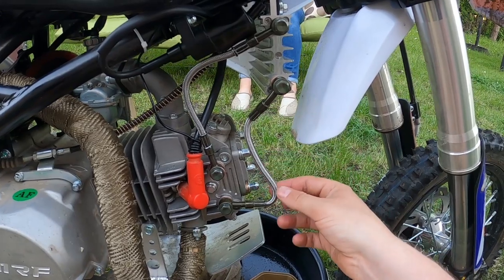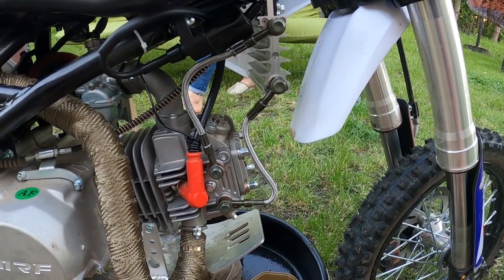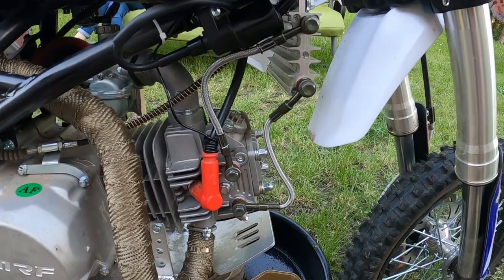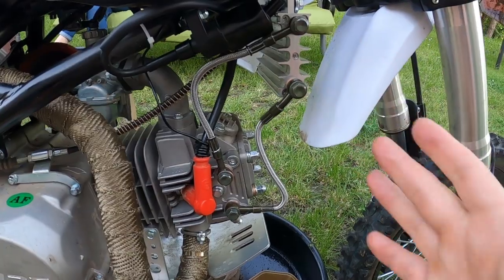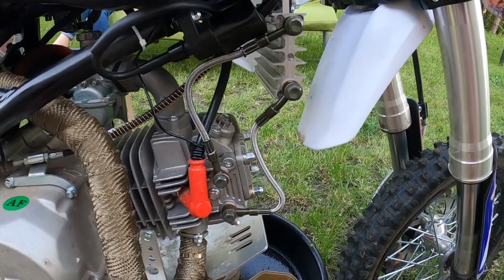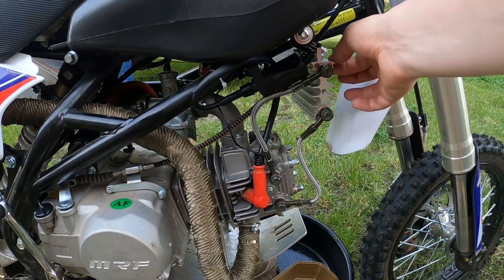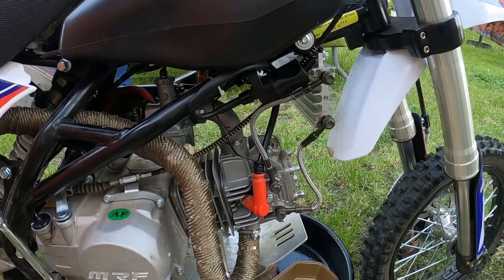I forgot how it all went and assembled it somehow — as you can see. It's not so simple to put all those rigid hoses back in place. Let's see. I'm starting the engine — I cleaned it a bit from oil at the end so it's not so greasy. We'll see if after starting and warming up the engine the little cooler heats up. The hose definitely needs to be purchased. I got a bit tangled up with all this, but you know how it is — when you do something for the first time, it's like it is. OK, starting up — let's see if there are any leaks, because I'm always afraid to overtighten aluminium — the thread will strip and that'll be a terrible mess, having to buy a whole new cooler.